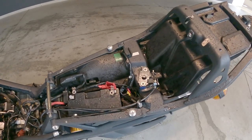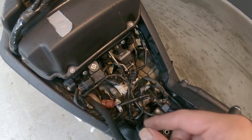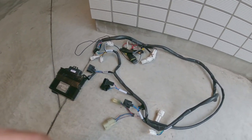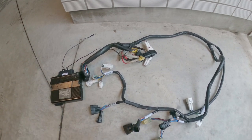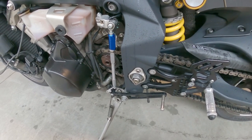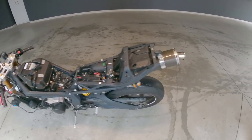So what I've done today is — if you remember there was a lot of messy wiring down there — I've removed the Rapid Bike ECU and put all the factory plugs back on. So all the injectors were tapped into, the throttle position was tapped into, gear position and O2 were all tapped into with this adapter harness. But I wasn't happy with how the previous owner had done it — the wiring is pretty poor, just masking tape and stuff like that. So for now I'm going to actually just run the bike like this and see if it's any different, because I did a bit of research and the quick shifter isn't the one supplied by that Rapid Bike company — it looks like it's an extra 250 euros to get the quick shifter add-on. So I think I'm just going to ride it with the stock ECU and see how it feels, whether it feels less powerful or runs rough because of this exhaust.